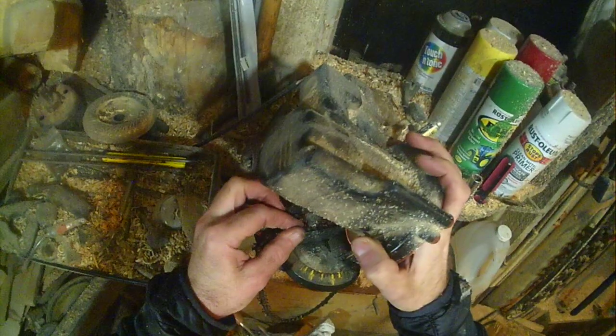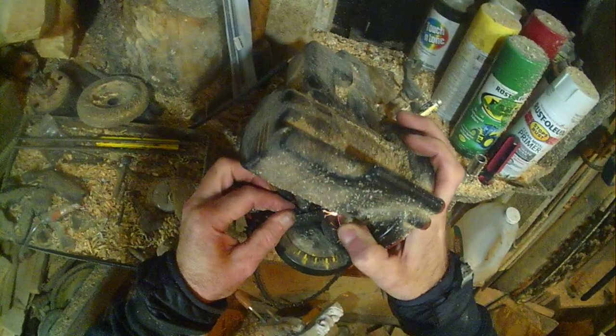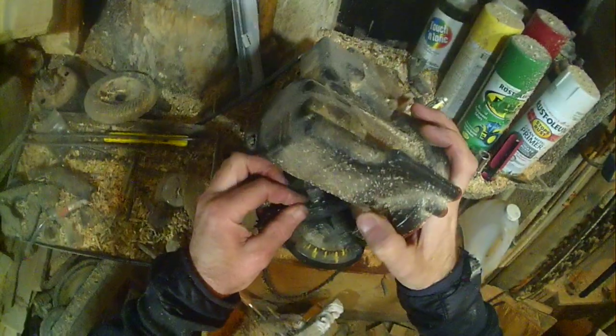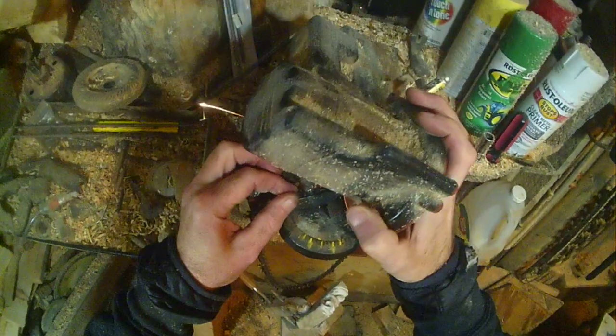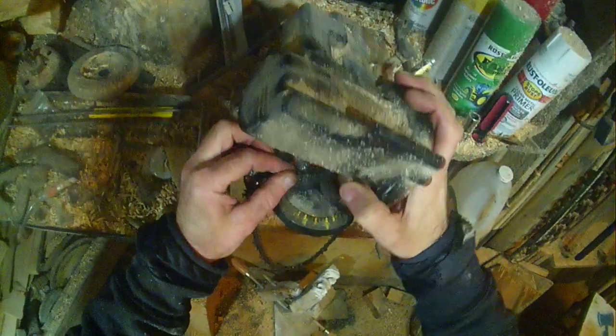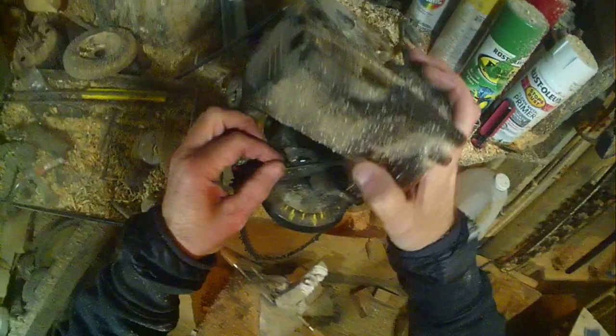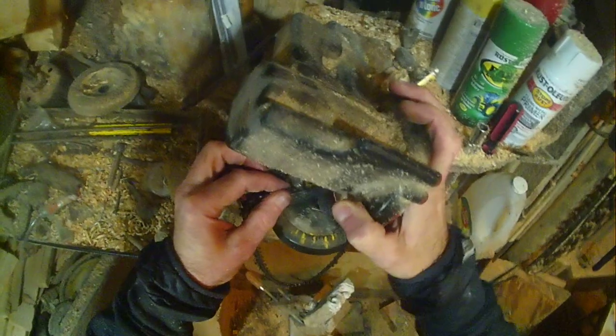There's times where I'll need to sharpen a chain maybe 5 or 6 times in a day while I'm using it. And scuff chains are great because I can bring 3 or 4 scuff chains with me and only use the file to touch them up. Or if I only need the one chain and I'm happy with the way that chain's cutting, I can touch it up throughout the day. But you see how quick that happened.